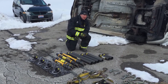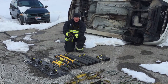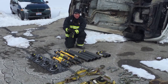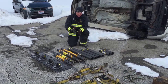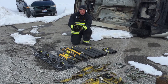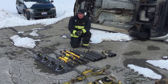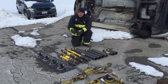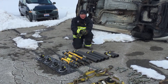On sideways vehicles — vehicles that come to rest on their side — there is a huge need for stabilization to the high side. There's a lot of different struts on the market. We're going to focus on the Highway Paratek VSK kit. This is a 26-piece kit, which sounds like a lot of pieces, but the whole cache is right here. When you put these pieces together appropriately, they store in a very small area on your rig. They give you four working struts that give you about six feet of length for your attachment points, with nice 12-inch base plates as load distribution points.